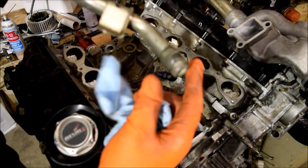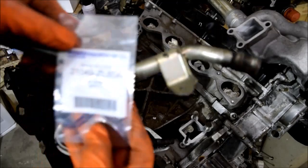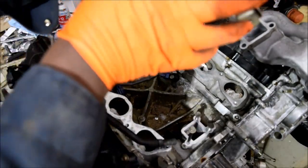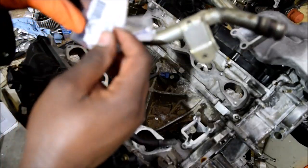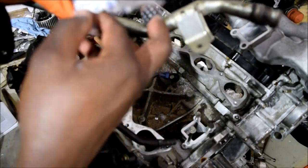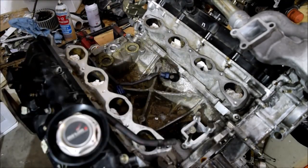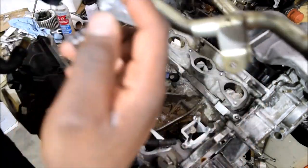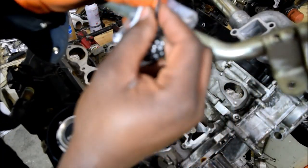It's okay for the most part. There is an O-ring that goes over here. The O-ring part number is 21049ZL80A. I'm going to take my dirty glove off — it's gone to a point where I can't keep claiming the glove is just stained. So here's the O-ring ready to go on there. You've got to lube things before making it happen, so Vaseline is my friend for such situations.